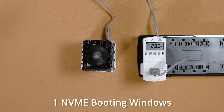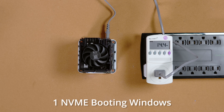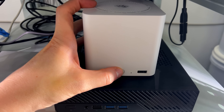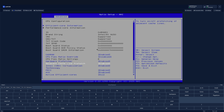Before adding more hardware, I grabbed some quick power readings. With one NVMe installed and booting up, it was fluctuating between 15 and 20 watts depending on fan speed. This was likely also due to the fact that it had Windows installed at the time, which I didn't dig into because I knew I was going to wipe it and install Proxmox. I then moved it to my home lab rack and connected it to a Jet KVM so I could remote control it. I powered it on, Windows booted up, and I said nope and reset it manually. I hopped into the BIOS and confirmed that it supported virtualization and also disabled Hibernate and Sleep since this would be a server.